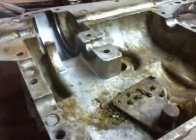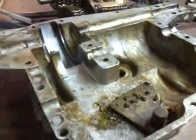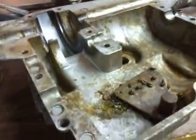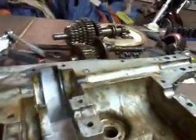Of course, I'll probably take it apart anyway to clean it up thoroughly and put some bentonite grease on it. That's another thing: do not put lithium grease in these Transaxles. I did, on the shifter plate, before I realized it doesn't use that. But that's all the grease I had at the time. I just wanted to see if it would free up the shifter plate. I didn't put it in any of the gear sets or anything, and I definitely will not do that.